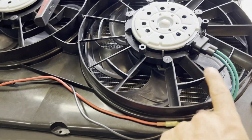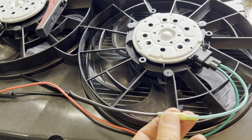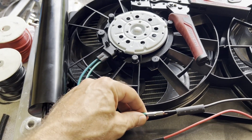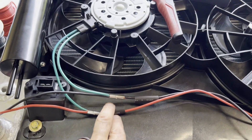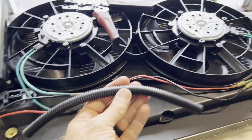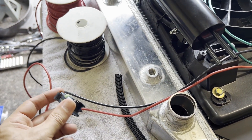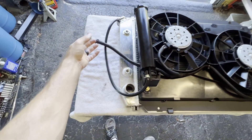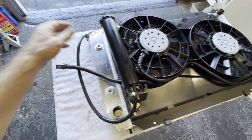Building the wire harness now — it comes down with nice heavy crimped connections to 12-gauge wire, heat shrink on there. Where the wires from both fans come together, I had to use a much heavier, larger crimp — the standard crimping tool couldn't do it, so I had to get out the hydraulic crimper which gives a lot more force for larger connections. Still got to put the heat shrink on, neaten up the wires, and eventually put corrugated wire wrap to make it look nice. On the outer end we'll get the WeatherPack connector on and be ready to plug into the car.